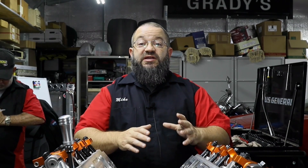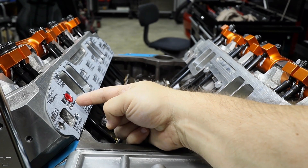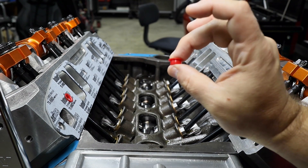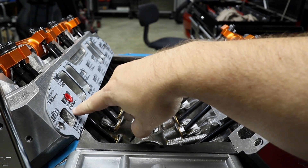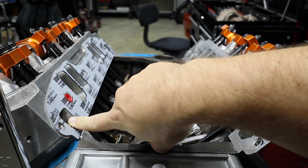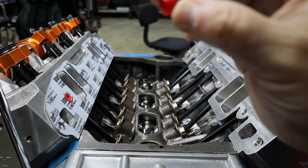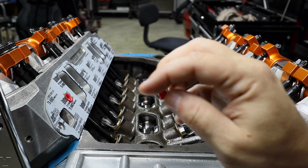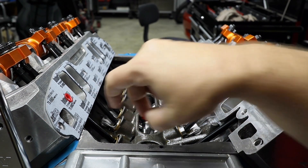If you've never dealt with a high rise intake or performer intake, it's all pretty much the same process and the same steps. There is one small thing that we're going to do a little bit different on this one. This thing right here is the only thing that is different — it's just a little plastic keeper, like a little T-cap type piece. It goes into the side where your bolts go in and helps keep the gaskets in place, and it'll align fine once it's in there. We did have to trim this up just a little bit — we took a little bit off the far edge with a simple razor blade, just trimming the very tip off. Once we were able to do that, it fit nice and neat in place, allowing us to keep it retained.